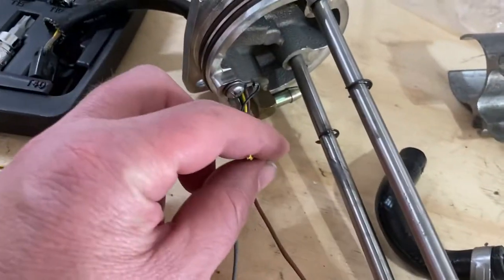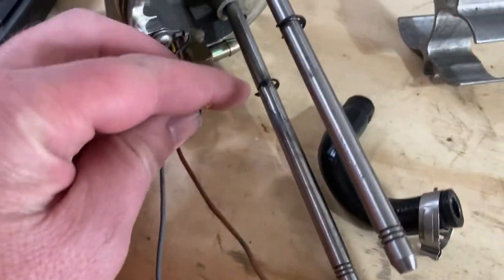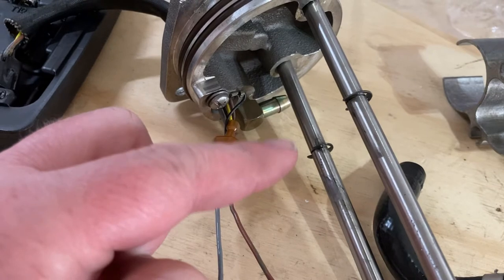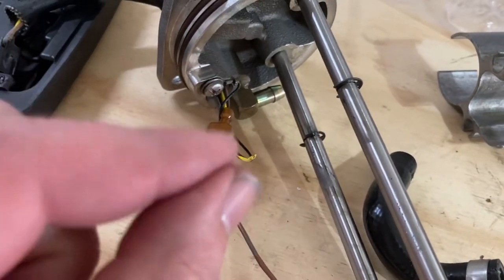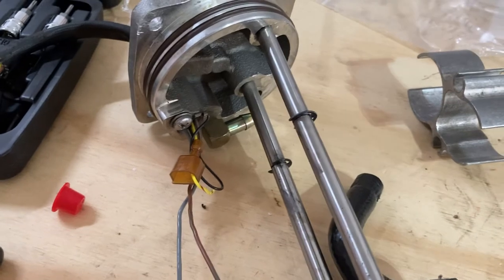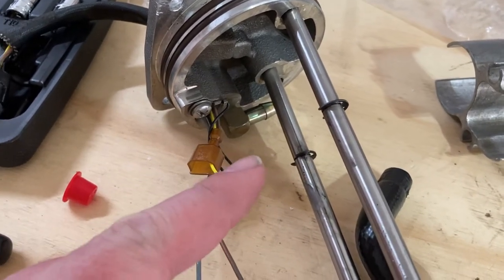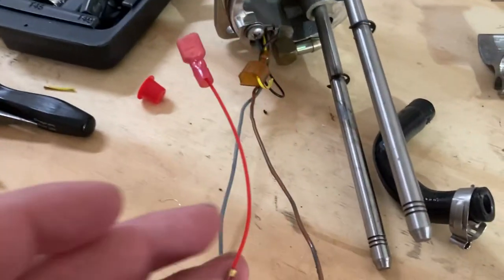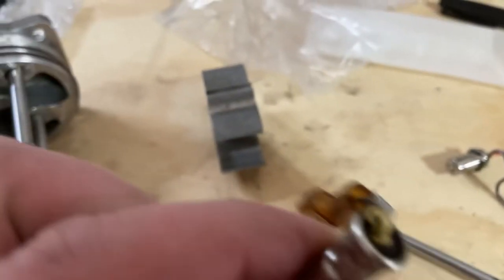So what I have to do is go to the parts store, in the process of pulling out the pump. This is the low fuel circuit. It was pinched and you could barely detect some bare wire. So I'm not gonna deal with that. I'm gonna run and get a spade connector or just a terminal kit. And this is plenty long, the new wires. This is what was on there. So you can see that's a little bit of an upgrade. Thanks again, Revision Moto. You probably have saved the day.